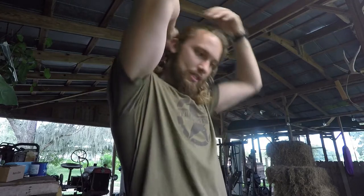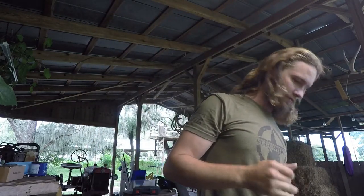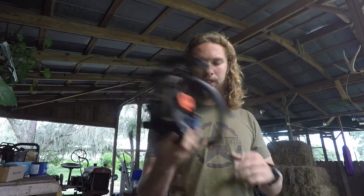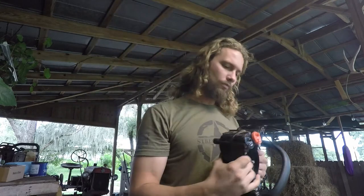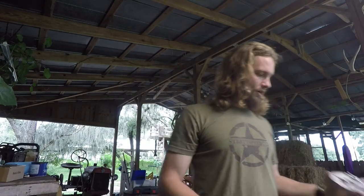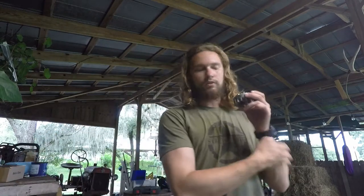I haven't been doing a whole lot with videos lately, but I was just going to come do a little work on our new saw. I picked up one of these Echos — the Echo 2511T — which I said I'd never do. We ran it on a couple jobs and at first it sucked — literally bouncing in and out of wood, had no torque. First thing I did was take the spark arrestor out, that helped a lot. I'm in the process of advancing the timing. One of the top threads on the crankshaft just barely rolled over and screwed me over, so now I've got to find a die — it's an 8mm fine thread, which is horrible because you can't find them anywhere.